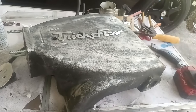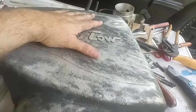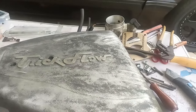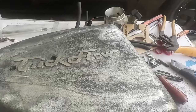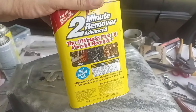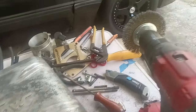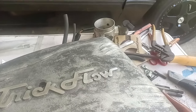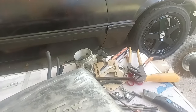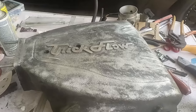At this point I am a couple hours into this. It was a lot on there — of course it is, it's a factory black manifold, so it's powder coated and then they painted multiple layers over that. I've used this paint remover, put it on five or six times, let it sit, and used a wire brush. I've got it down to where I think it's good enough to paint now. The idea is to make it look good, but it can't look too good because it's not going to fit the theme of the car. I'm going to go ahead and start getting this all set for paint.